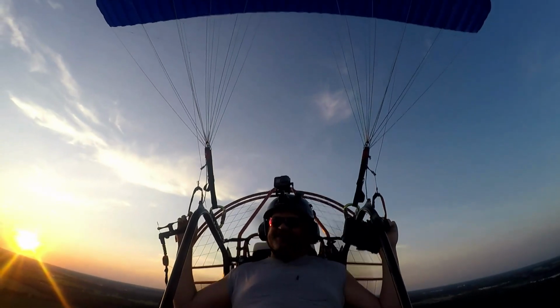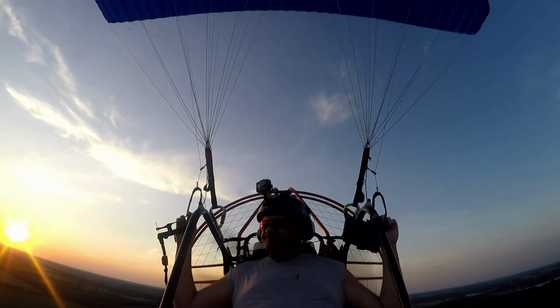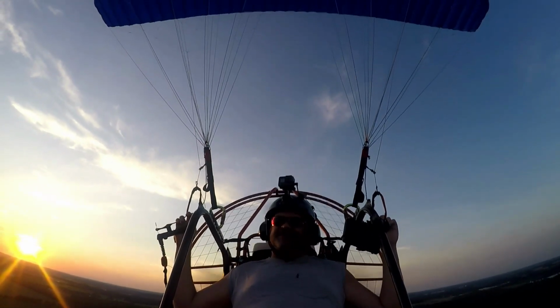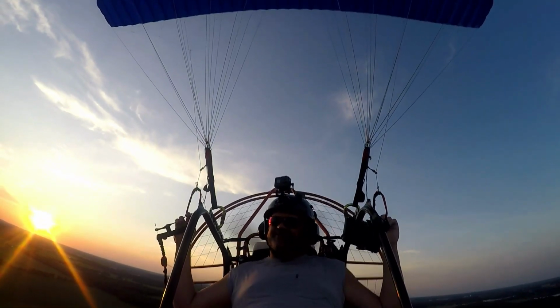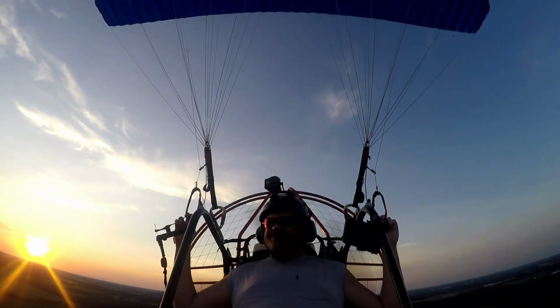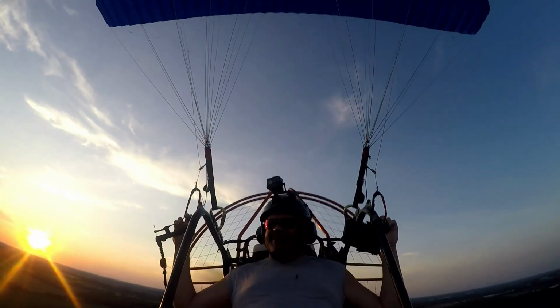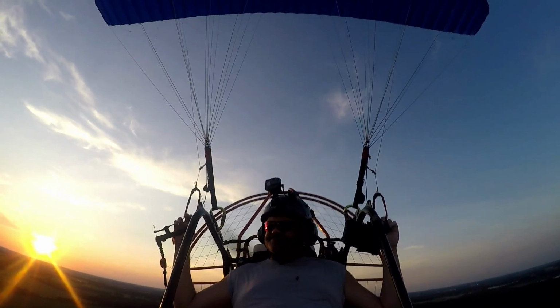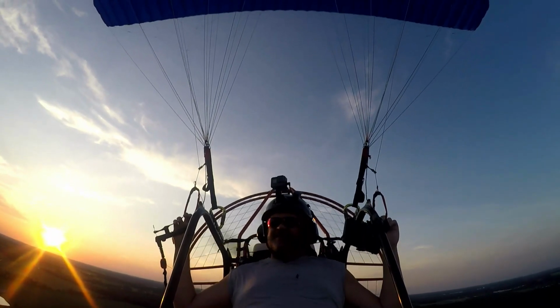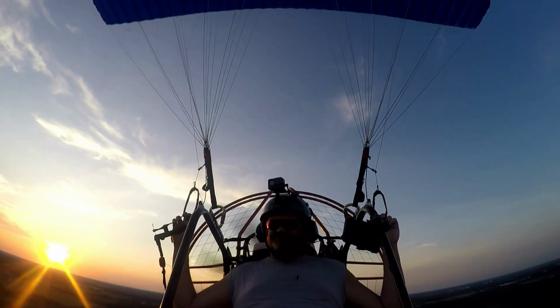But I'm trying the 155 jet because it was suggested to me. But I don't remember having the stutter problem with the 160. So I'm going to land real quick, put in the 160. I may still have enough time to get back up in there and give it a run. But I'm going to start losing some altitude so I can bring it in for a landing.